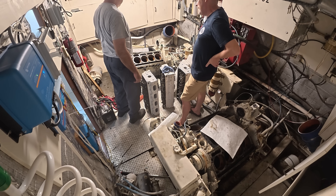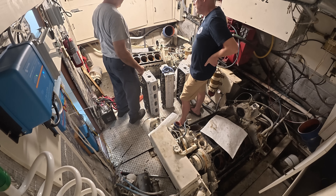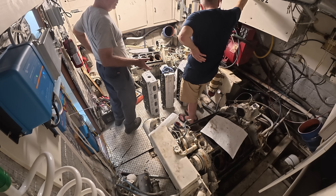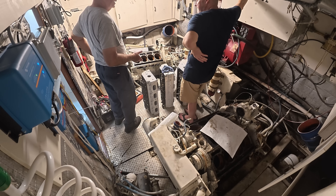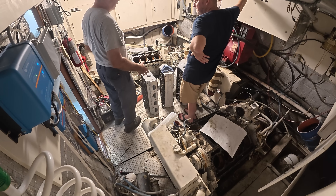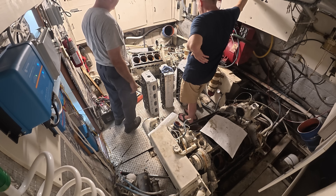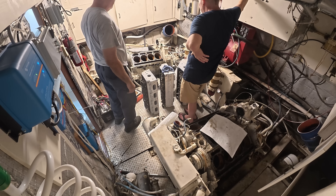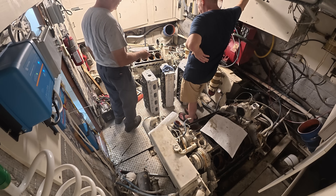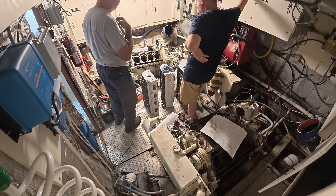And are you painting? Yeah, we're going to paint. Everything that I'm going to put in here is going to get painted. What we'll do is get a couple of air conditioner filters - put one on a fan on each side, and that way it'll suck up all the paint mist. Basically, to paint the blocks in our lab, we've got to assemble the entire engine. Then after it's been running, just degrease the whole thing and paint as much as we can.